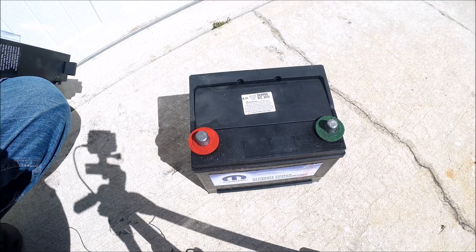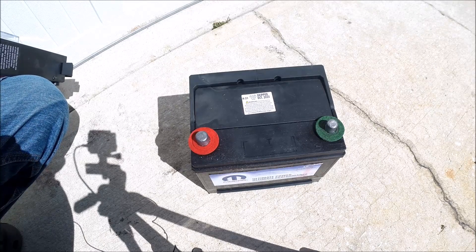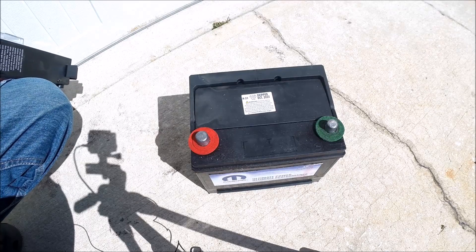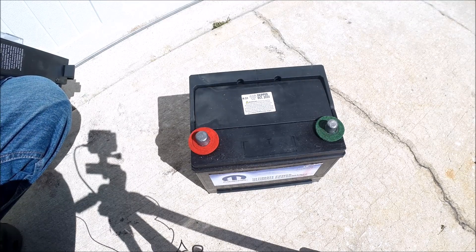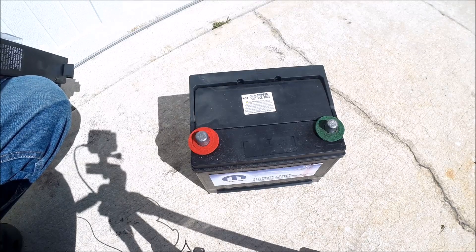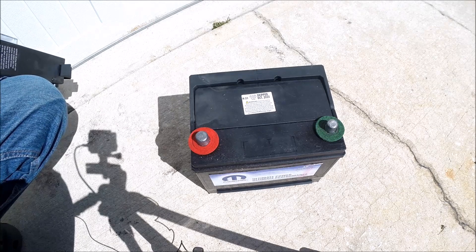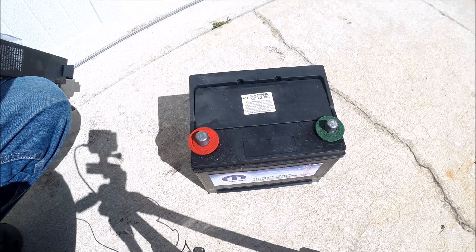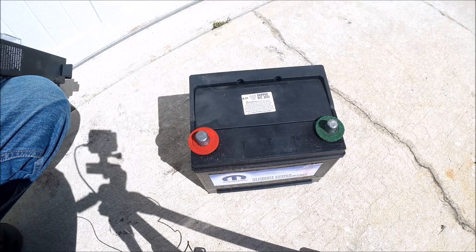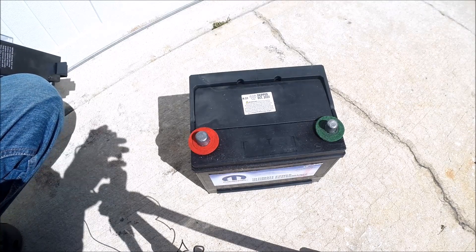I did change the battery out in the car anyway. This one was about 20 months old and the battery is so hard to get to — since I was already in there I just put a new one in, which cost about $180. That did not solve the problem though; I still get the clicking sound when I turn the key. I talked to several people and concluded that the starter is the problem. I don't regret changing the battery since I cleaned all the terminals while I was in there. Thanks for watching.